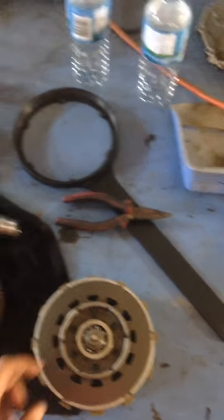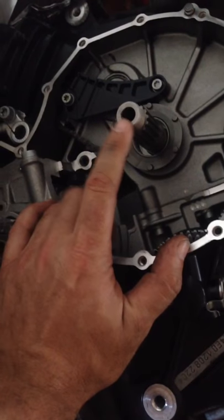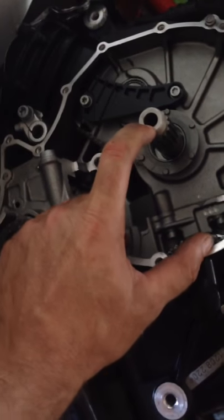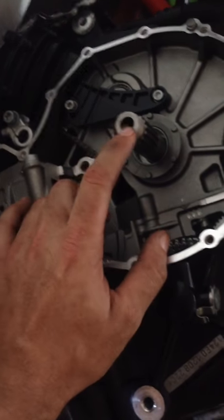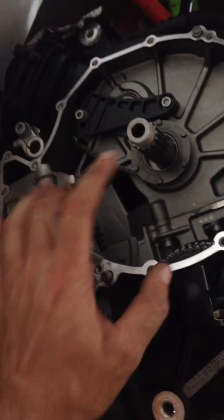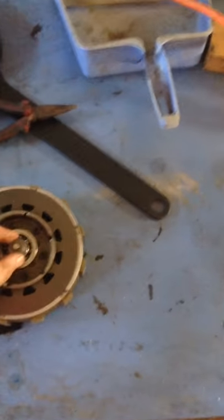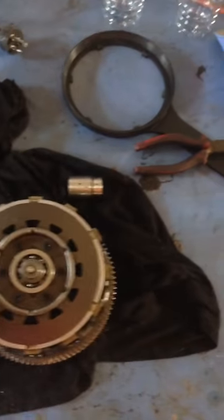The components are definitely different to my 2005 model. I still had the original plug that's in here with a little cut slot. They had a service bulletin to remove it and put another nozzle or jet in there, supposed to get more oil into the clutch basket. But none of this actually worked.